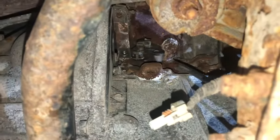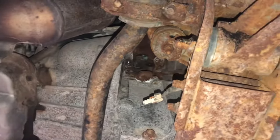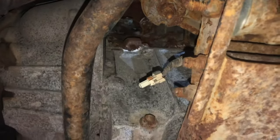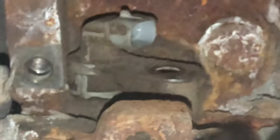The sensor is located right over there — this piece. You're going to have to remove the starter out of the way in order to see the crankshaft sensor. Come down underneath the car and you should see it right over here. That's the crank sensor.